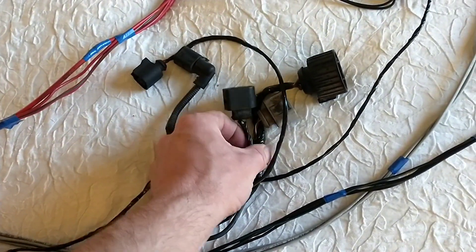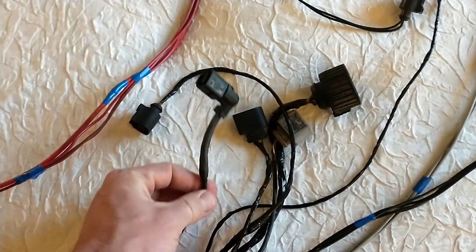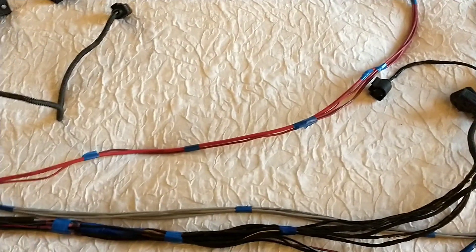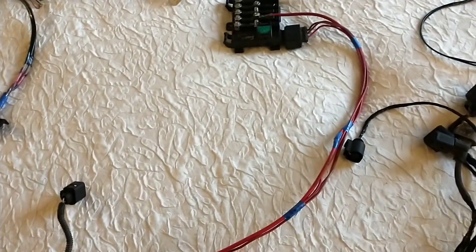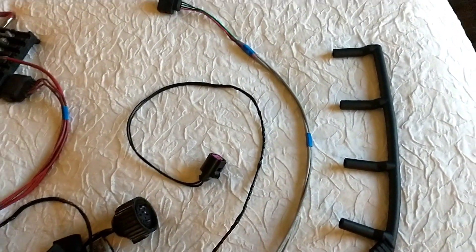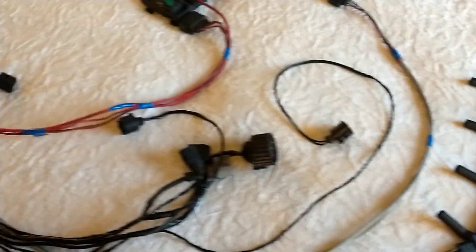On my other video I started from scratch. Because the harness came out intact, all the main external sensors — your crank, your cam, your injectors, the fuel temperature and coolant plug — I did not have to touch at all. That really cuts down quite a bit of work. Outside, you've got your N75 valve, the alternator plug, and your MAP sensor, as long as you're going to delete your mass airflow sensor and all the EGR stuff.